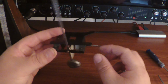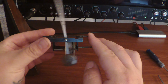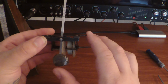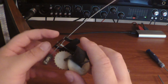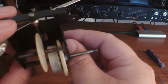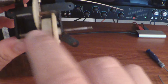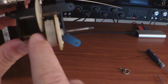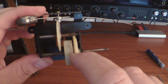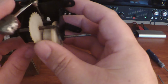And there you have it. That's the actual metronome mechanism. And look at that. It's fairly simplistic. How they made these is really interesting. So, back to what I was saying earlier, this is the shaft that you wind up. And then there's a spring loaded back here, and it retains its tension. So that's what constantly drives this metronome and keeps it working. As long as there's spring tension, the weight of the metronome will drive itself.